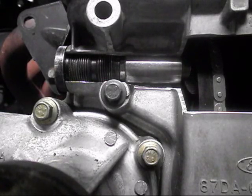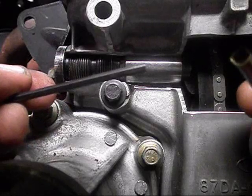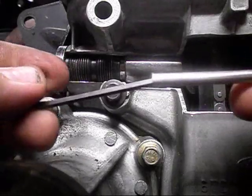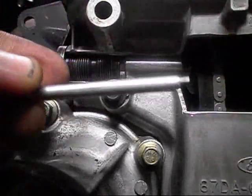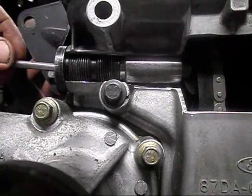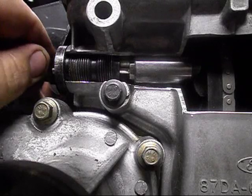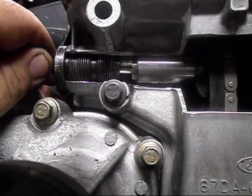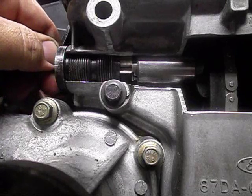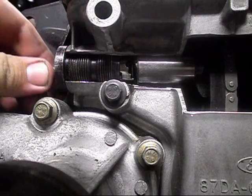To put it back into the operational position, what we need to do is put a little bit of a tube onto our Allen key. I've just got a piece of broken-off car aerial which has worked for the best part of 10 years. As you can see, it butts up here against one end and we've got a little bit left over. Now put it back into the tensioner, find the right spot. Give it a bit of a push in and turn it anti-clockwise, and the tensioner starts coming back out to its original position.